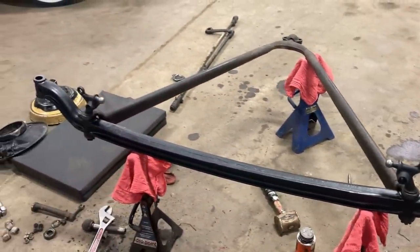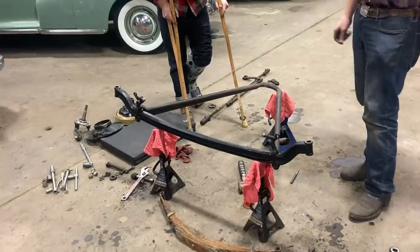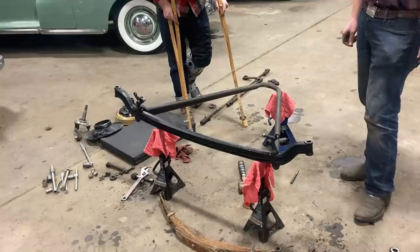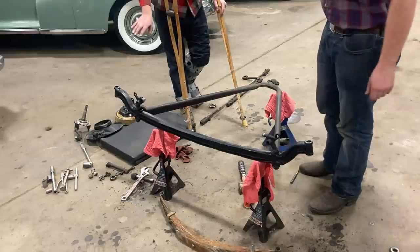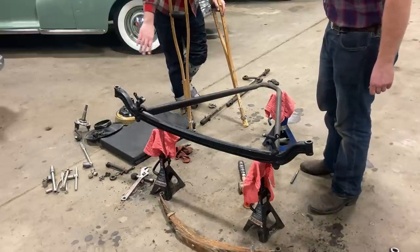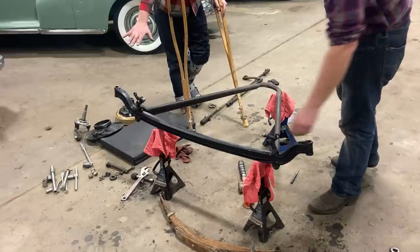We're going to keep cleaning. Jim's got a bit of cleaning to do. And we still have to do the kingpins, brakes. Then we can reassemble the whole shooting match, stick it back under the frame, and roll her in. That's all in a day's work. We've got our new axle in, wishbones cleaned up, all original paint, NOS perch pins. Look at that. Thing of beauty.